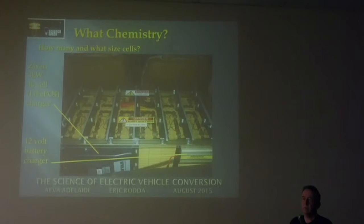Yeah, by disabling the controller, that's the safest thing to do for the batteries, that's for sure. Yeah, and if you take it down too low... I played funny buggers then, not knowing which one it was. I thought, well, I'll find out by driving around at home until I stop, and I'll put the multimeter on. Unfortunately, doing that the second time got me down to the point where that cell wouldn't take charge, and I had to recover it over many hours with a phone charger.